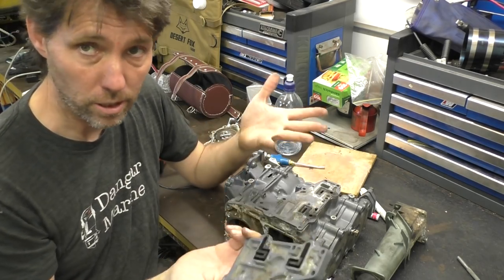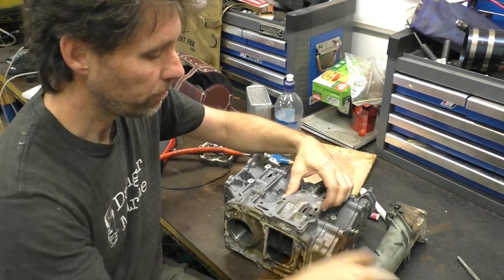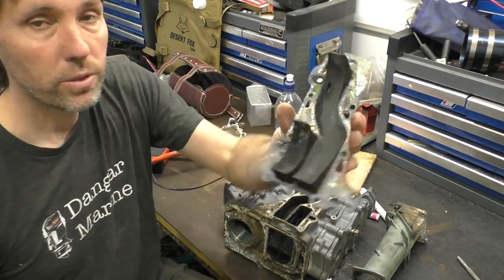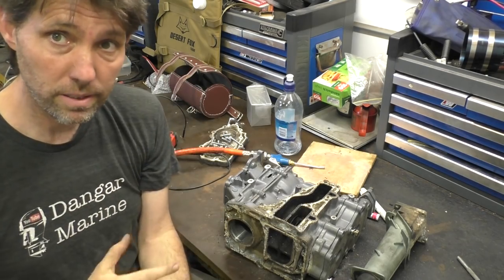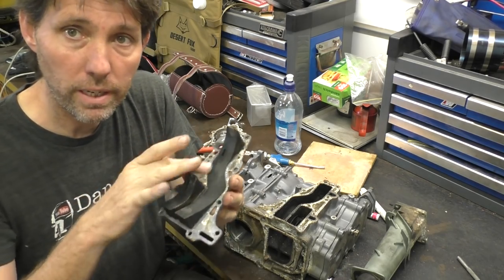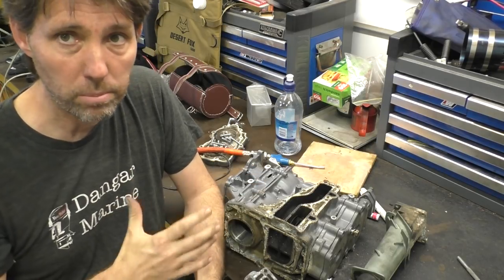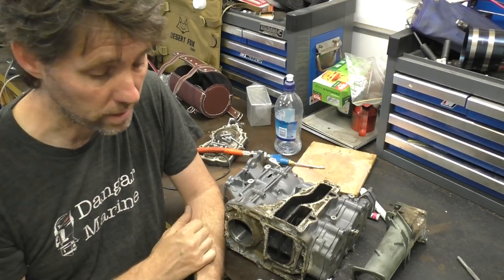These always have gaskets on them — obviously missing here because it's been pulled apart. Underneath the cover we've got the exhaust ports from the outboard. These shapes are designed to deflect the gases and give a smooth curve to flow, so you don't get turbulence. Quite a bit goes into designing this side of a two-stroke motor, because to get those exhaust gases out it needs a specific shape to the exhaust — whereas with a four-stroke, the piston simply pushes the exhaust gases out.